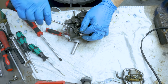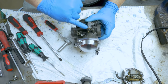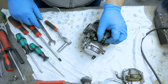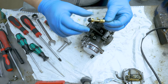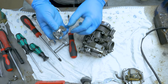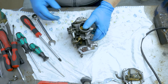Next step - take off, not just loosen, this bolt which connects the choke shaft to the choke mechanism and the choke piston. So this choke shaft frees up - this should pull out. You can take that off as well. Choke piston is 14mm on these Mikunis, including the 1100 BST 40 - that is a 40mm as well. I'm taking this out to make sure it's in nice shape - and it is. We're going to pop off this choke block, which just pops off with the gasket like the other one. Gasket - there you go.